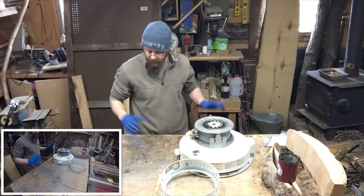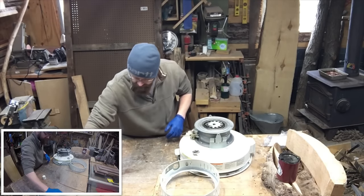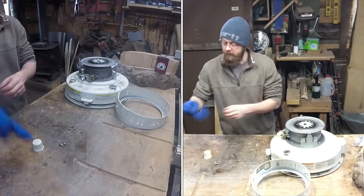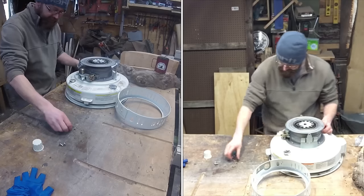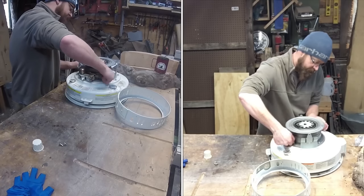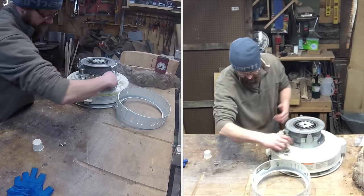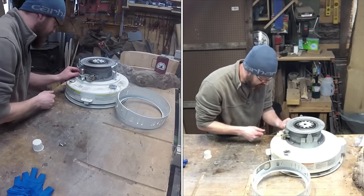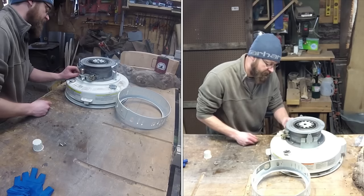With the old wick outside airing out, we can start assembly. We need the knob, all the wing nuts, and our bolts back. I've got four wing nuts — gloves off, we don't need them anymore. Start putting the wing nuts back on. This does have a rubber seal so tighten these down pretty tight to seal everything back up. I'm going finger tight — not using a wrench, not over-tightening — just as tight as you can get with your hands. That should be enough to compress the seal and seal everything up.